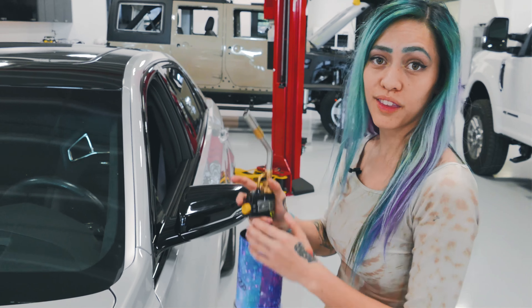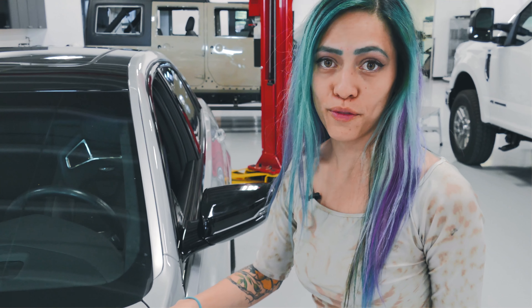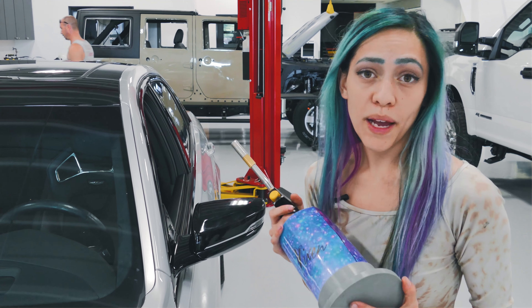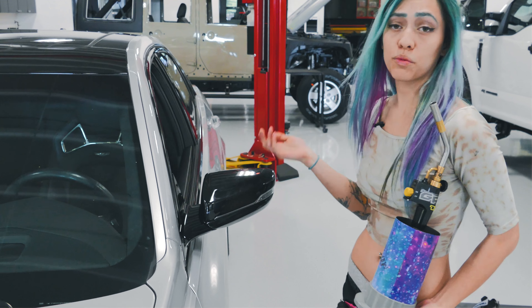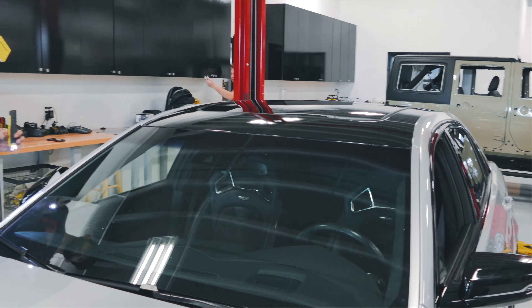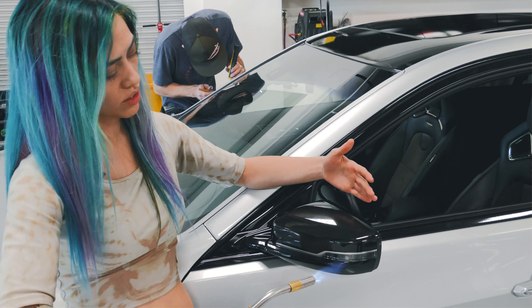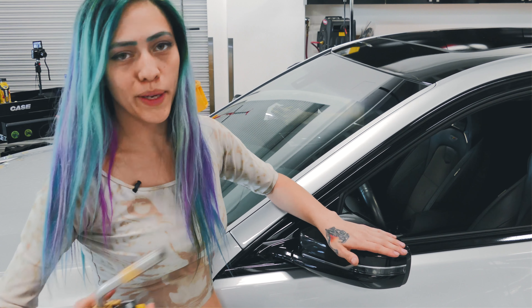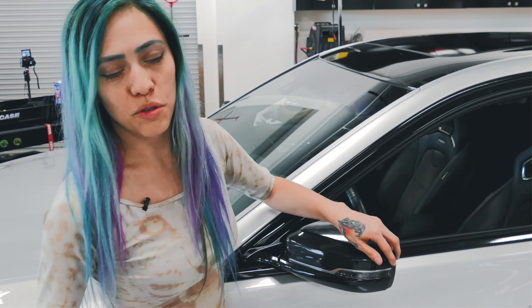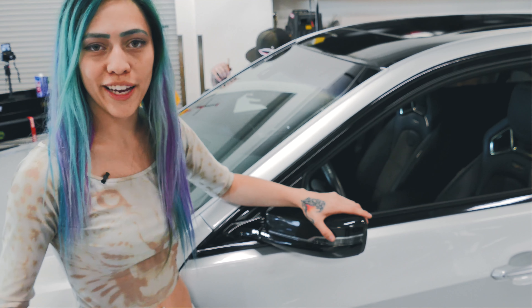Another good thing with gloss black: you'll notice when you're doing roofs or hoods with gloss black that your squeegee scratches the material. A really good thing for getting surface scratching and install scratches out is actually a torch. You can't get them out with a heat gun, but if the flame just barely touches the material, it actually takes away the surface scratches. That's only for gloss material. Scientifically speaking, it is a temperature like 225 degrees. If you're using a heat gun, you could use a digital thermometer, or you wait until it's gummy and it burns your hand.